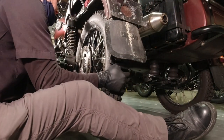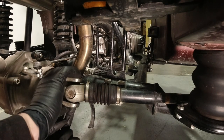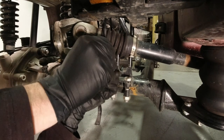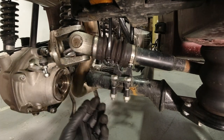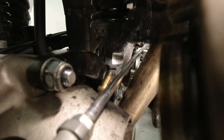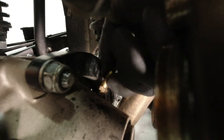The reaction link that you loosened earlier should swing away. Now you're free to remove the rear wheel assembly. I like to take the drive shaft and zip tie it up to the frame so it's out of my work area. Depending on the year, you'll have a variety of different breather options. This one requires a 10 millimeter wrench to remove.